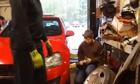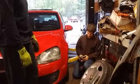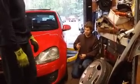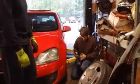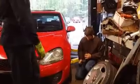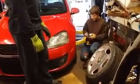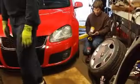I'm wondering if we're losing some power because this is like a slot box, like a Pittsburgh non-hardened impact socket, and it's just wallowing it out probably. Pretty sure. I think our only other option in this shop is a 12-point, which I just don't want to go there yet. I think that 12-point should be our absolute last resort. No, I don't think we should even think about that. What? Using a 12-point socket, because it's going to strip.